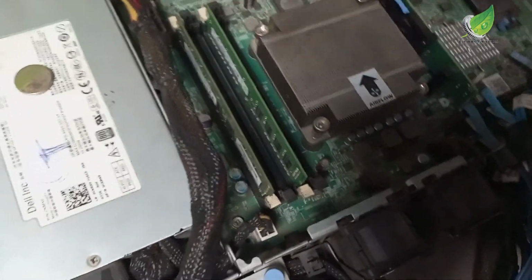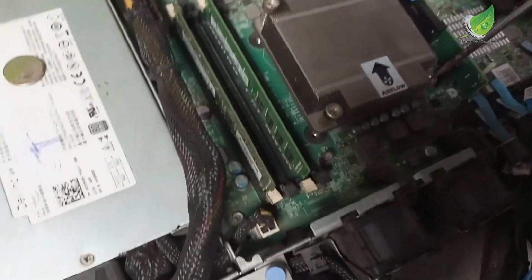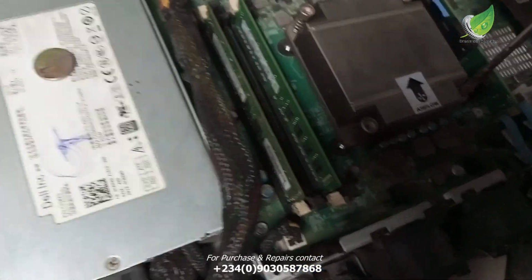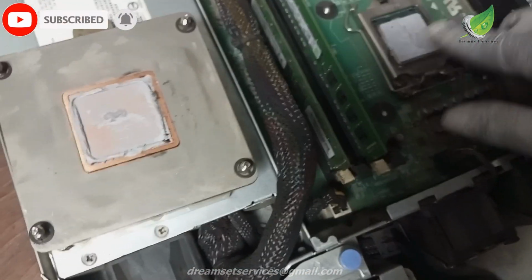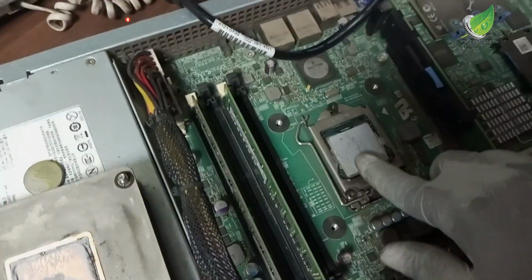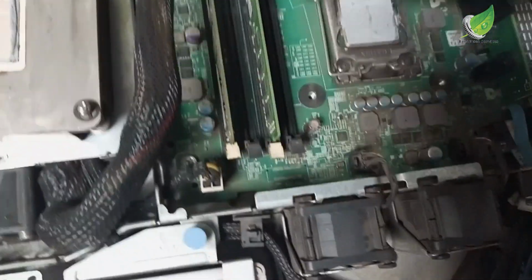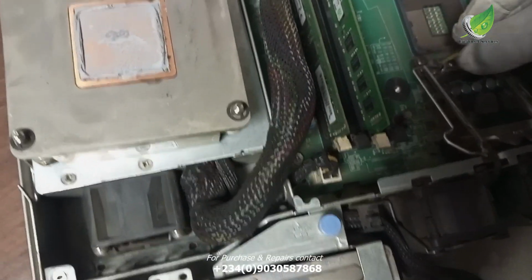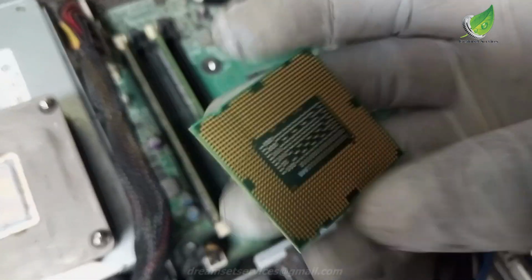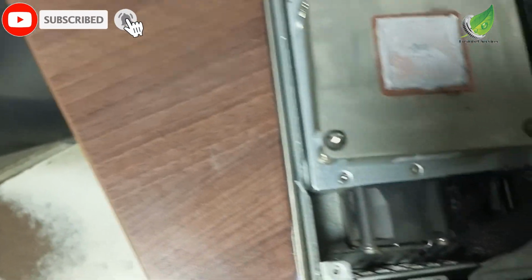So the next thing I'm going to check right now is my processor. That is the last thing I'm going to check. One of the problems that processors have is with heat, because they work over time. You can see this is the paste. The cooling paste is completely dry. So the particular server is not able to dissipate the heat that comes into it, to transfer the heat into the heat sink,